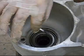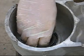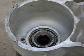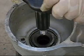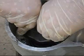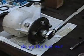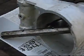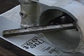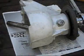Here's a 0.152 inch spacer. Here's the collar that bears on the bearing. And here's the end of the driveshaft. So now I've got the torque wrench on one end. The only problem with this method is it's quite difficult to stop the other end rotating, so I've just got a bar jammed in the yoke to stop it rotating.